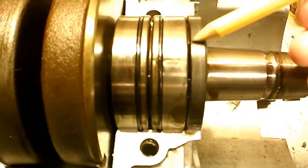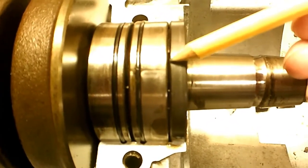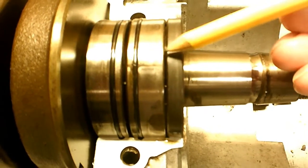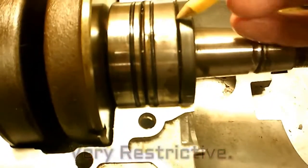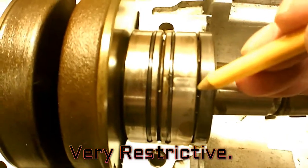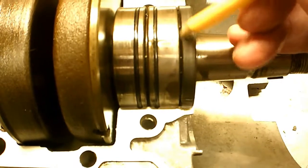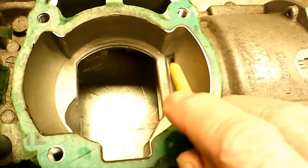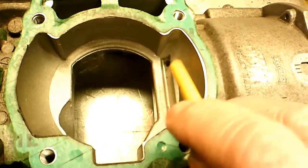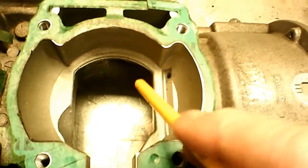This is what I'm talking about — those little feet that space the shaft seal away from this end bearing. You can see one right here, and another one right here. The only place that oil can get in or out of this bearing is this little tiny slot right here. That's where I modify to make sure that oil can go in and out of there. This is the oil way here, which enters into this transfer port here, where there's going to be a lot of mixture of air and fuel.